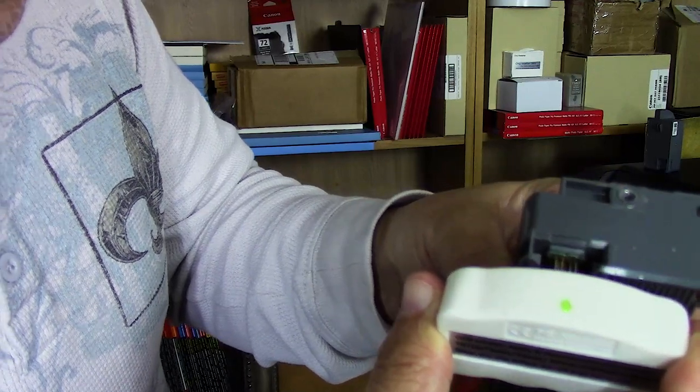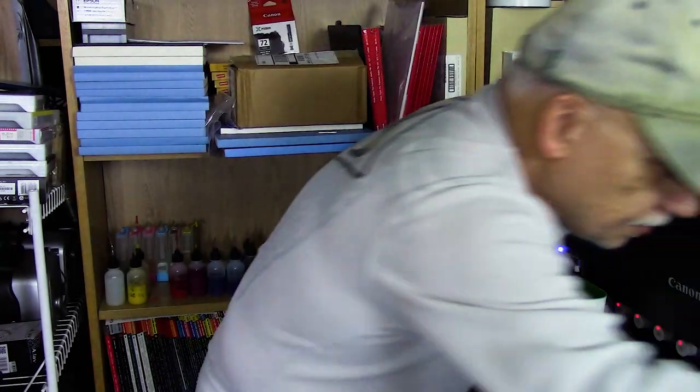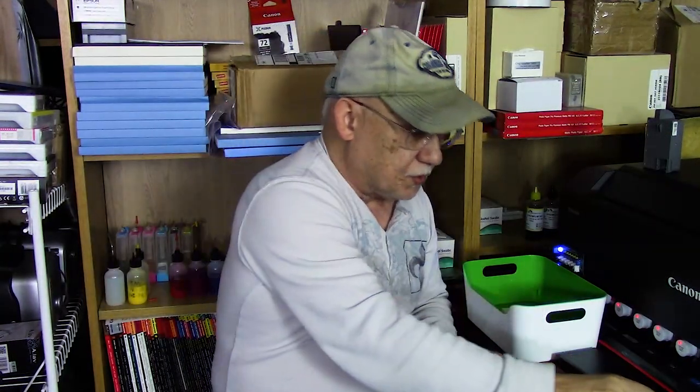This cartridge is now reset. Once you reset this cartridge and dry and reinstall the pads, pop the lid back on — you can remove the cartridge you just installed, go through the same process with it, and replace it with the one you just reset. Because the minute you install the other cartridge, it erases this chip's code. So this chip, now reset, will be seen as a new one — the printer only knows the one currently installed.